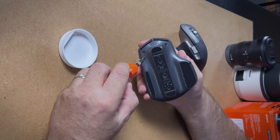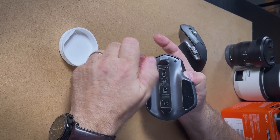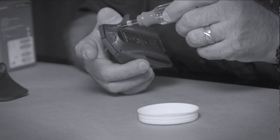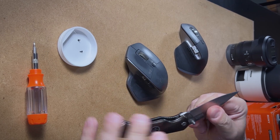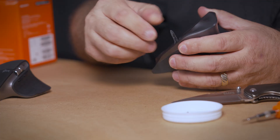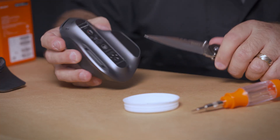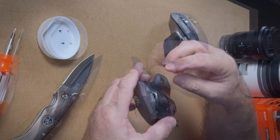We don't want to lose our screws, so first I'm going to take out this one screw here. It's a little difficult to lock in there — there goes one. Good idea to make sure it's turned off as well. It doesn't matter if the battery is still in there, but just make sure it's turned off. Now I'm going to take off these pads using a knife or sharp implement to get underneath them and leverage them up. Just peel it back — as you can see it already has double-sided tape on it. Once you've got it, it'll pull off quite easily.